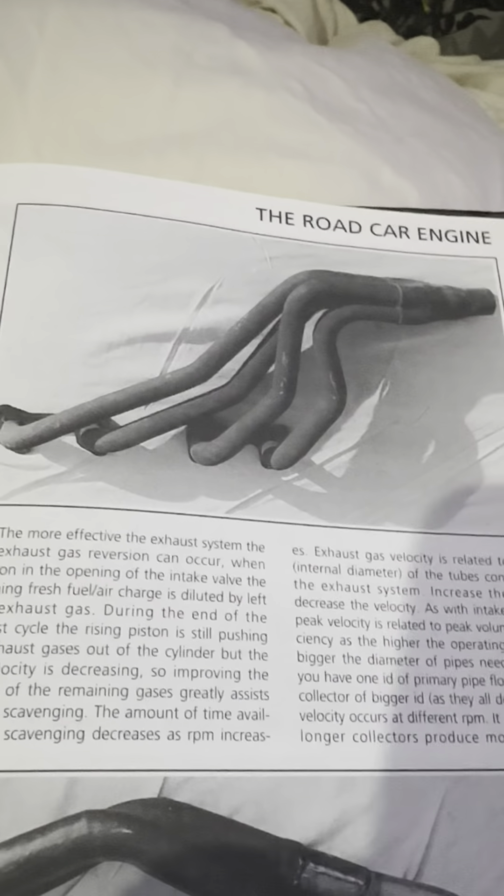The other thing I looked at tonight was my oil filter assembly. I need to figure out a way to move that and have enough space to move things around up in the front passenger corner of the engine bay. I think I want to try and mount the remote filter to the front panel that supports the radiator, or to the inner fender well. Mine has another mounting bracket on it, but it looks like it's just there for clearance. I'm thinking I might be able to get away with something not as thick, or just take that piece off and mount it directly to the fender.